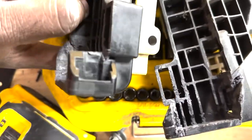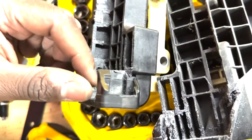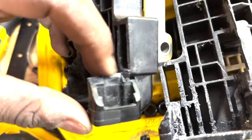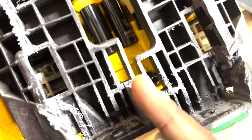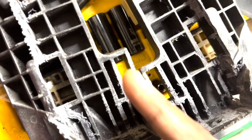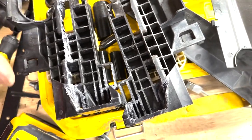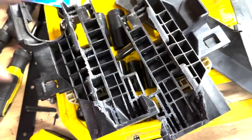You don't have to cut these sides off, but you do have to cut them at least down to this halfway point right here. You can cut this out. This is just blocking for it. It doesn't really make too much of a difference if you do. And if you're wondering, you also have to basically try and shave millimeters off of this bit by bit until it fits in snugly. After that, you do a bit of trial and error, and you should end up with a very good or at least decently fitting bracket that will house your aluminum radiator.